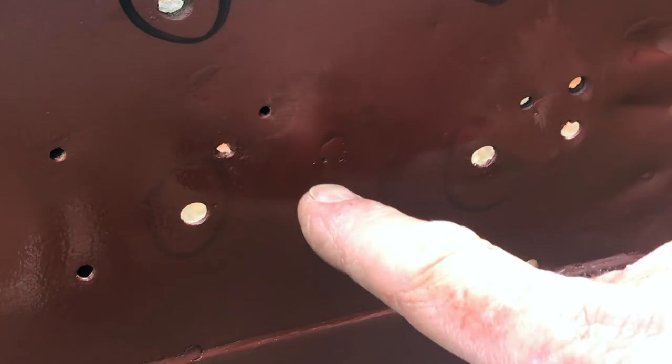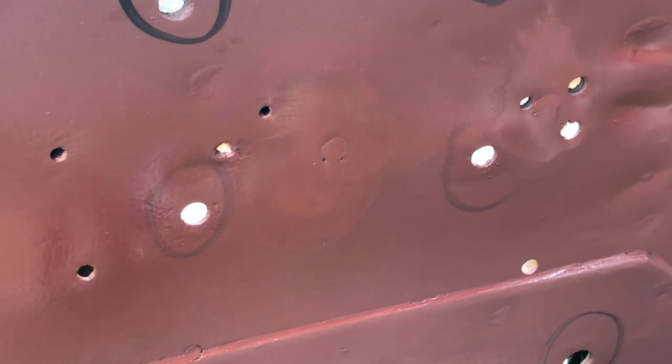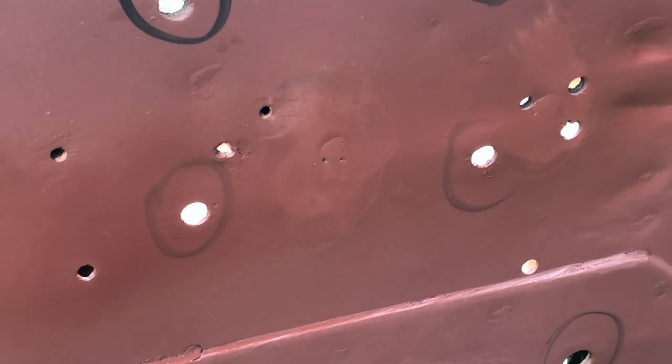The holes nearly disappear now. I'm going to have to go back in here and touch this up with just a tiny bit of body filler, but very, very minuscule. And again I can come back another time — I've still got a ton of holes to fill, but the bare metal won't flash rust on me while I'm gone.